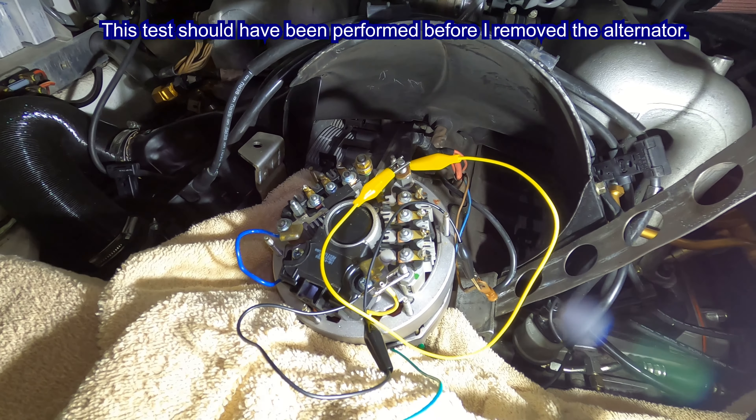So what I'm going to do now is test the voltage regulator. I'm going to take this guy very carefully and slowly and put it back on the post for the blue wire. And I'm going to come back. Nothing. I do have power - no light. So I'm going to test the voltage regulator next.